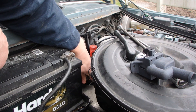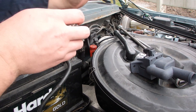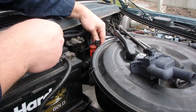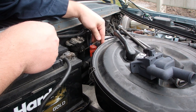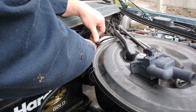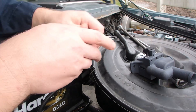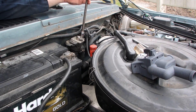On diesel models, they say you need to replenish coolant through the upper radiator hose in addition to the reservoir, to facilitate bleeding and prevent engine overheating on initial operation. Since I'm going to lose minimal amounts of coolant by doing it this way, I don't think I'm going to do that — but do as they say, not as I do, so it would definitely be good to follow through with that. I'm guessing maybe it doesn't bleed air out as easily as the original mono valve — I really don't know on that, so let me know if you've dealt with that before.